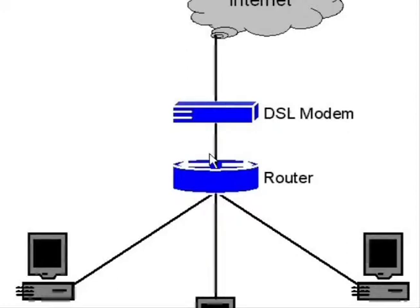We're going to start with setting up the internet connection. This picture here shows a simple setup for a home or office network. This cloud represents the internet, and the telephone wire goes to your DSL modem. Behind your DSL modem there is an Ethernet port. The Ethernet wire — with an RJ45 connector — is a little bigger than the telephone wire's Category 3 connector. You take that Ethernet wire from the DSL modem and plug it into your router's WAN port.